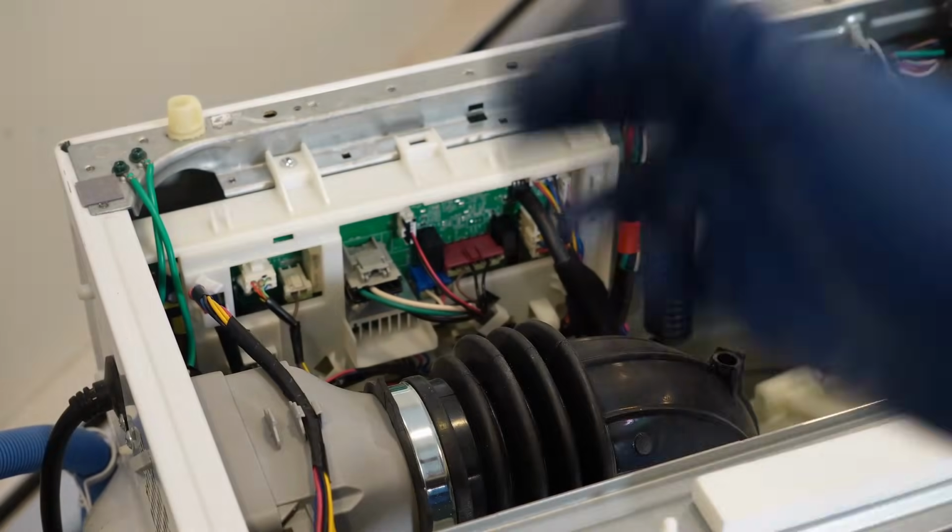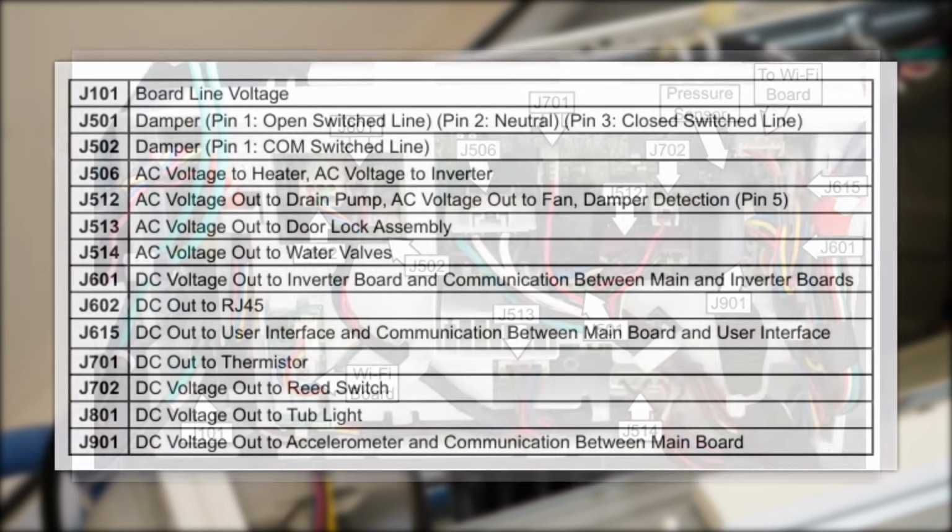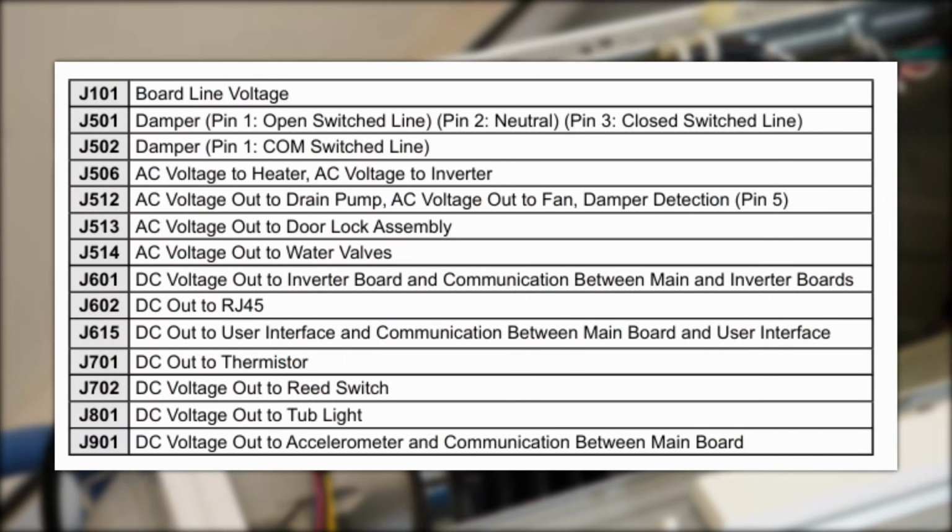These are the names of all the wire harnesses on the GE front load washer. By knowing where these are and what they are, you could use your multimeter to test various components to figure out which one could be causing an issue. This is what each of the harnesses do, and I'm going to include a link to the service manual for this machine in the description.